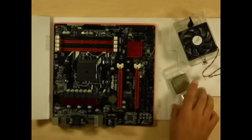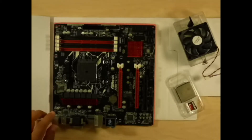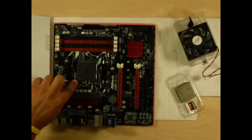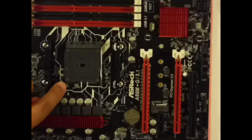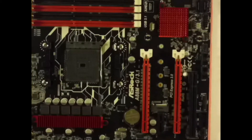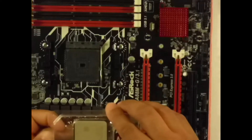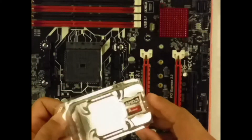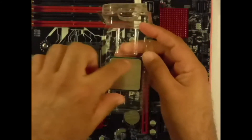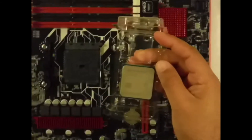This is the most crucial part. This corner here shows the pin — there's a little black angle, a little corner that's kind of dug in. That's the zero or pin-one marker. Now if I look at the processor, there is a similar triangle right here where my left thumb is. That's going to align there, so if I set them up as I would drop it in, it needs to be oriented in this manner. I'm going to arrange this because my thumb won't twist that way.